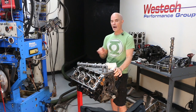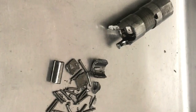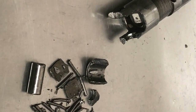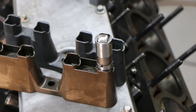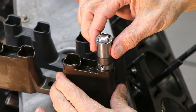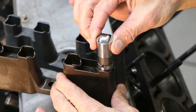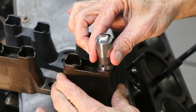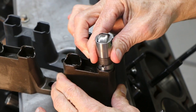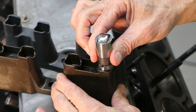I think we've figured out why this is happening. We saw a similar thing when we did the compound boost and lost that lifter entirely because we let it run too long — it was just wearing down like that. I'm going to put this lifter in the lifter tray and show you what's going on. If you take a look at the lifter in this original high-mileage lifter tray, it's really sloppy — this thing just drops in, there's no way it's holding. It can't move around too much side-to-side once it's in the bore, but what it can do is rotate. And if that wheel rotates relative to the lobe, that's going to wear that wheel — that's what we think is going on.